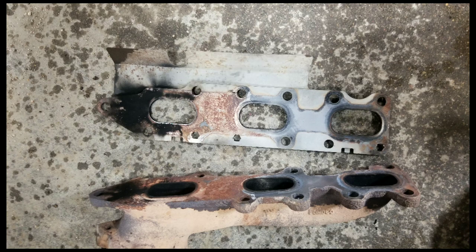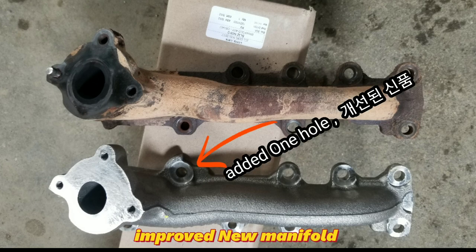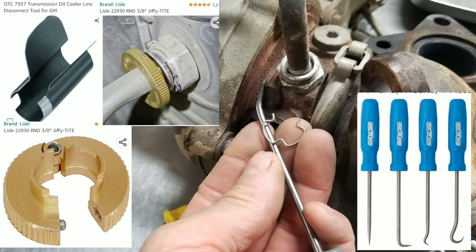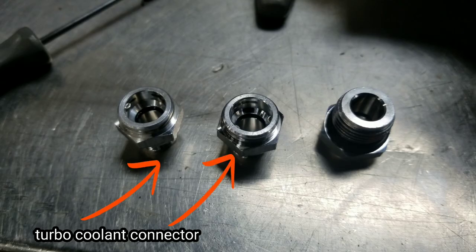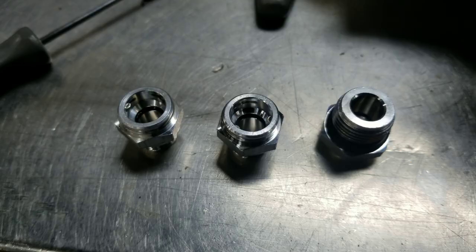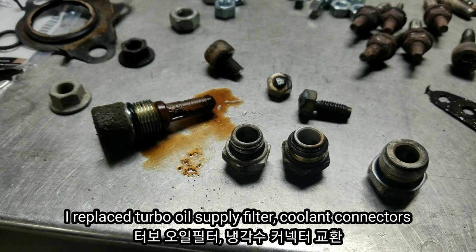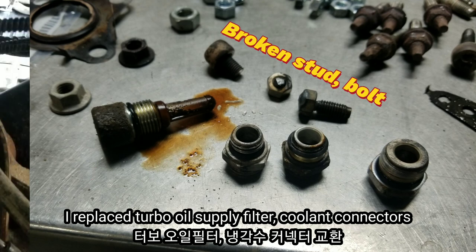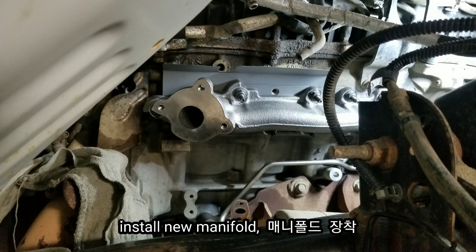This picture shows the warped manifold with a rattling gasket, and the bottom shows the new upgraded replacement manifold, because the original manifold had many problems. When you remove the turbocharger, you should replace all coolant connectors using a special tool — or pickup tools if you don't have the special tool. Replace the left-side two turbo coolant connectors, the right-side block coolant connector, and also replace the turbo oil feeding filter, coolant feeding, and other components.